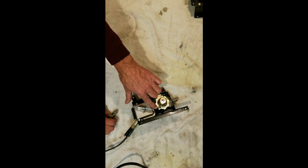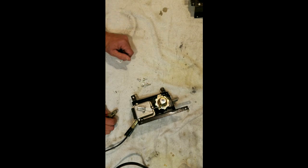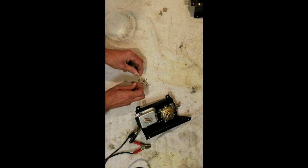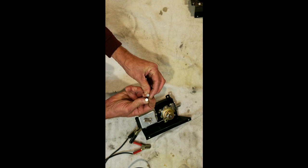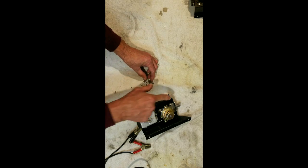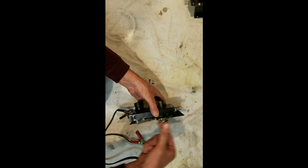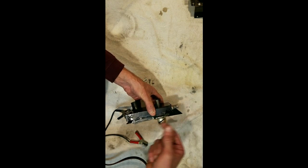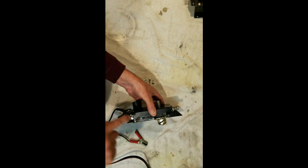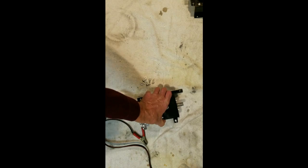I did have to mess with it a little bit - I had it too loose. I'd rather start out loose and then tighten it a little bit. Anyway, that's the way I suggest you set them up. These bolts here, I think they're 2BA - my eyes don't judge them the way they used to - four of those connected over to the fender well, so it mounts like that. There's a beam that runs around the wing on a British car and there's a ridge that runs around. These go in the ridge, and this is a bear to get in, but that's how you fasten it to the car.